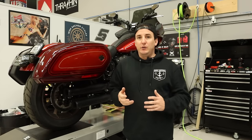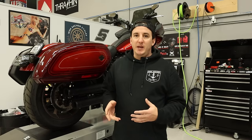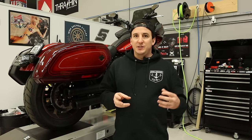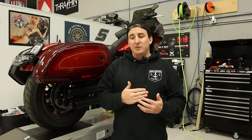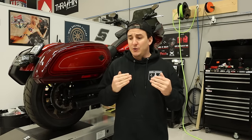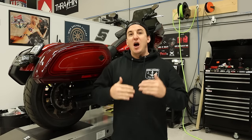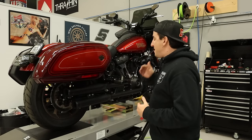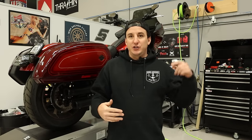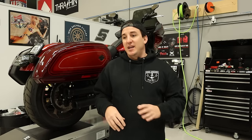Now, what's kind of cool about what Harley's done is, obviously some of the Softails come with forwards and some of them come with mids. And what they've done is created some P&A kits that allow you to switch back and forth, but they've created two different versions of those kits. So there's the easier, more expensive route, which is the non-OE version where you are not having to open up the inner primary to change the inner shifter shaft, or basically it sort of routes things on the outside. That's not our preferred method. Our preferred method is the P&A kit that comes with OE mids.